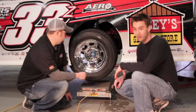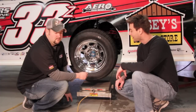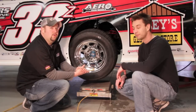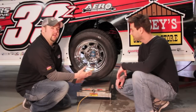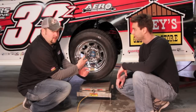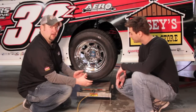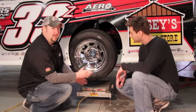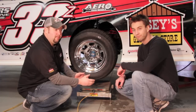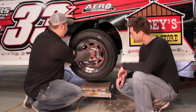The first thing you have to do before you scale the car is actually pull out the left rear axle. Zach's going to show you that real quick and why you do that. You want to pull the axle out because most of the time when you're setting the car on the scales you have it off the ground. When you have a solid axle system on the rear end, you want to loosen up one side from the other. That way when you set it down there isn't a bunch of extra scrub and bind in the rear end, which can increase your bite and your wedge numbers.